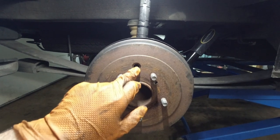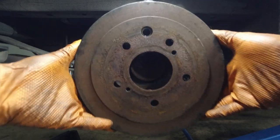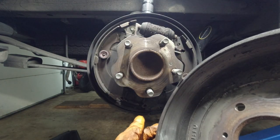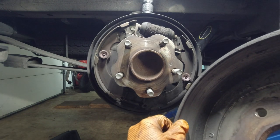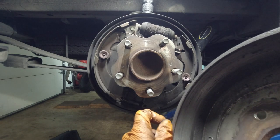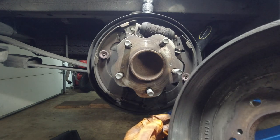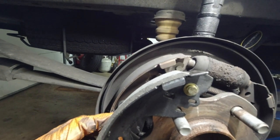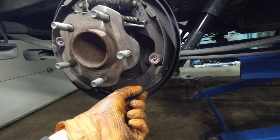It gave me quite a bit of trouble, and I'll tell you why. The owner of this vehicle waited too long to replace the brake shoes. You can see there's a ridge — it's actually pretty deep — and this part did not allow the shoes to clear the drum. So this drum is shot. Look at the shoes — they are gone. For comparison, this is how it's supposed to look; the braking material is pretty much gone. Look how thin this is.